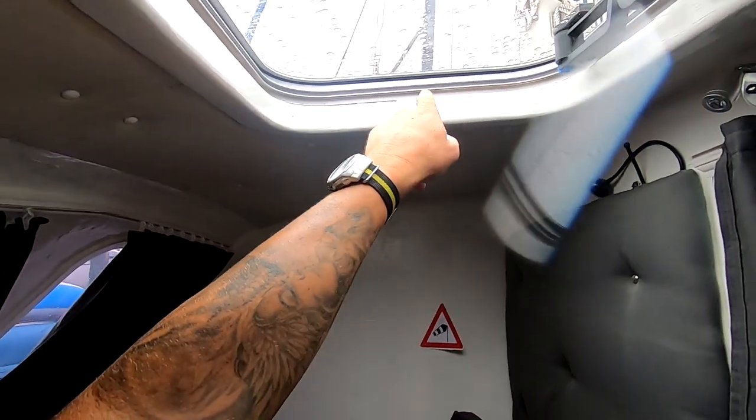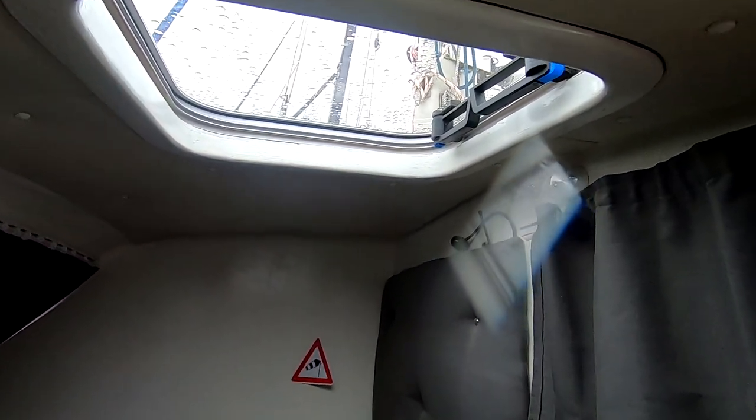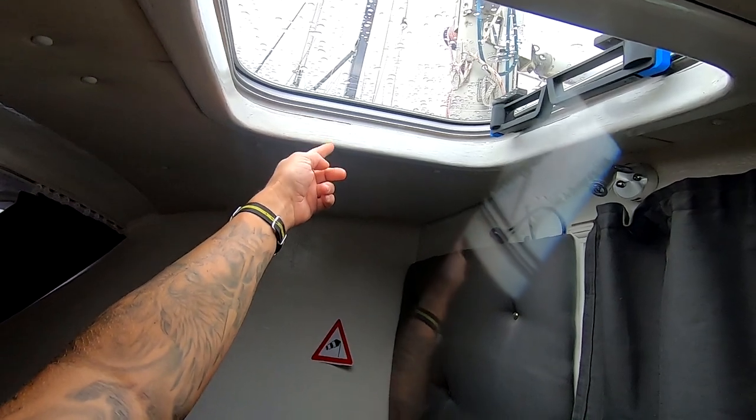Hey guys, so yesterday I found out the dark side of using butyl tape. I fitted these hatches a month or two ago now. Absolutely fine, not an issue. We had that really, really hot spell where it's been hitting almost mid-30s for, it seemed like forever, 2-3 weeks. Had a bit of rain, wet bed. So where I bedded this one on the outside lip, the butyl tape, I think it just got so hot it sort of melted down inside